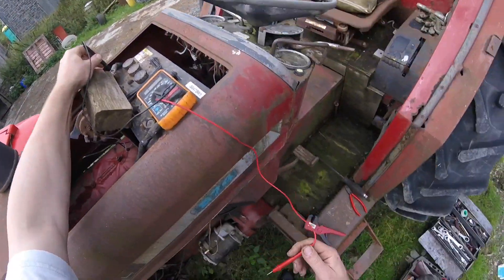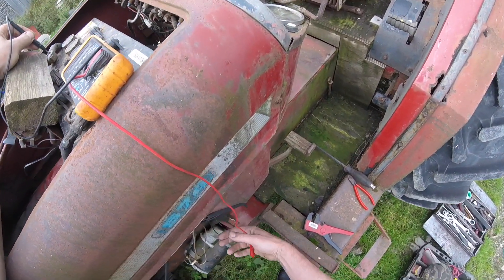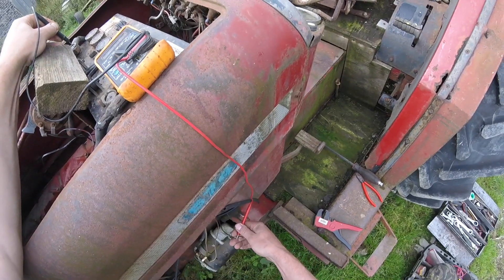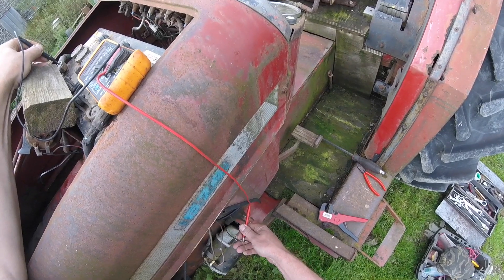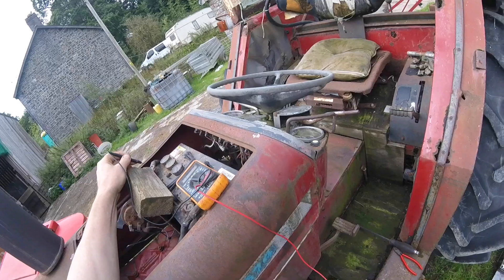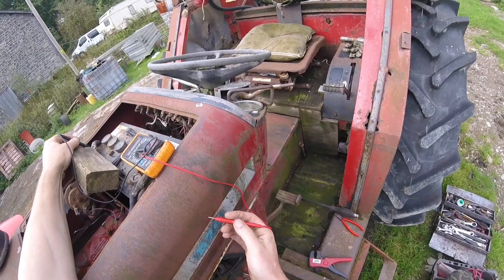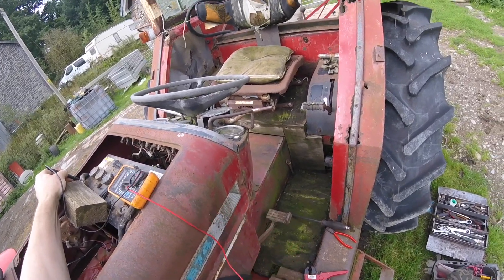So there is the earth on the battery. Now you go down here and imagine you don't know what those wires are. So as long as you've got a good earth on one probe and you've got a load of wires — say in the back of a radio — just earth this one correctly and go through them. The one you get the beeps on will be the earth.